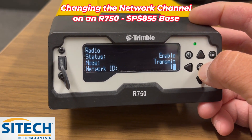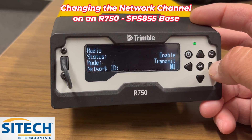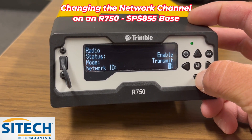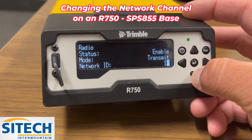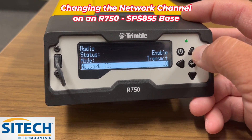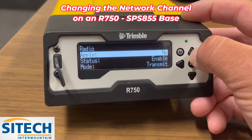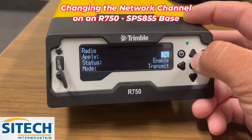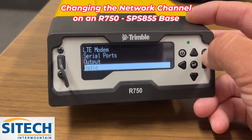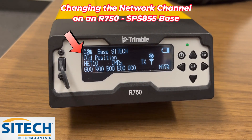Hit the enter button to be able to change it and you have to change each one individually. On the left side you can put one, on the right one two three — we'll put this on 10. Once you've got it on the number that you like, go ahead and hit enter. It highlights it again, go to the very top and make sure that you hit the option to apply change, set that to yes, and hit enter. Now you can hit the escape button and back out and verify that it's on the different channel — there's network 10.